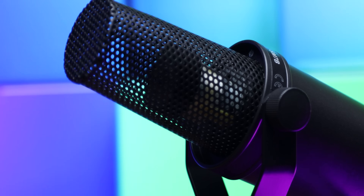The capsule itself, if you look at the front of this microphone, looks similar to the SM7B. The SM7B has its standard windscreen that clips in, and inside there's a metal housing and capsule — very protected, working well as a windscreen with the metal grid plus foam. The MV7 is entirely different: the capsule is really like a hybrid of the SM57 and SM58. It's super robust and well built, but it doesn't reject plosives as well. This microphone is definitely its own thing. That brings me to the windscreen on this $250 microphone — it is a very cheap, cheesy windscreen that I don't actually think works that well.